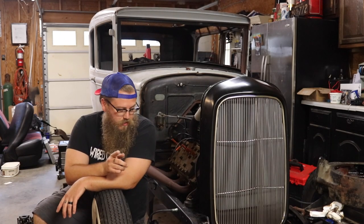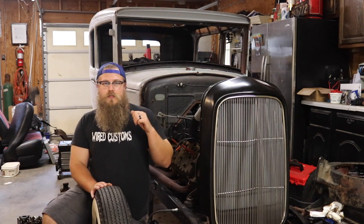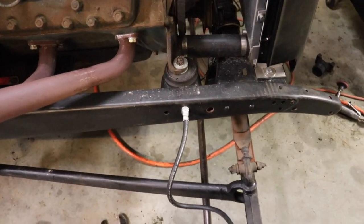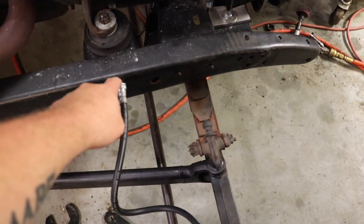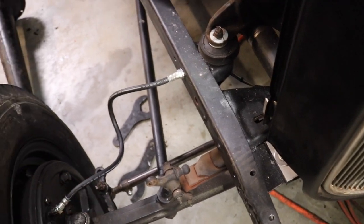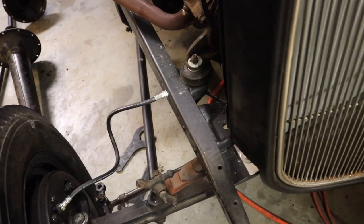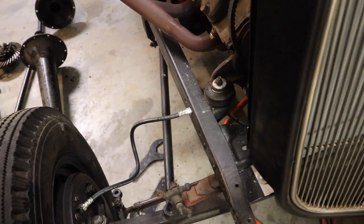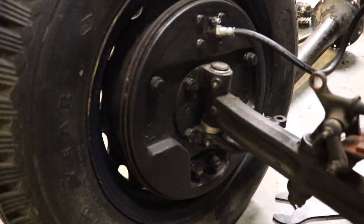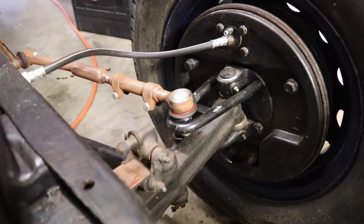A lot more time has passed since I started this video, but that allows me to give you a lot more thorough explanation. The front brakes are done, all my lines are ran, the rear brakes are done — this is a running, driving car right now. I ran my brake lines inside the frame and drilled a hole underneath my motor mount to make my rubber lines. I did get original 1939 Ford lines but they were too short, so I had a friend make these lines from scratch. I recommend getting the length right, and depending on what hard lines you run you should know what your threads are. These are banjo fittings — 39 Ford banjo fittings — and that's what that looks like on the original Model A axle. That's how I incorporated my steering to these backing plates.